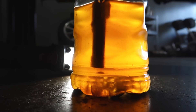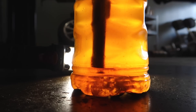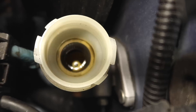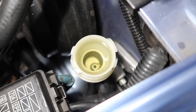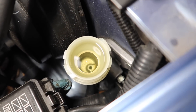This is going to show you how bad the clutch fluid is once the air comes out. You'll see the groddy stuff coming out — there it is. That's what the fluid looks like compared to semi-flushed. So we're going to flush it all the way out until it runs clean into the container, wipe out the reservoir, make sure all the debris is out of there. This isn't as bad as some we see, but now we can clean that out completely, put fresh fluid in, and flush it through. See how much better it looks — it looks brand new. It's actually amazing the difference. The clutch pedal feels smoother when you flush this fluid through because it is like a fluid cable.